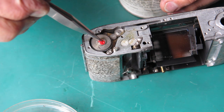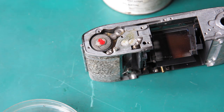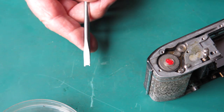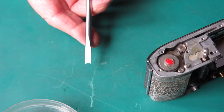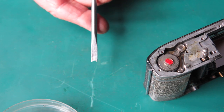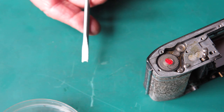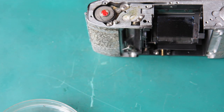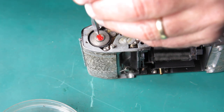I'm taking a drop of acetone and placing it on that screw head to soften the paint. I need to be able to unscrew that. I've got a screwdriver here — you can see the shape of it. It was just a simple screwdriver that's been cut away with a disc on a Dremel to leave two points. It's ideal for dealing with things like this.